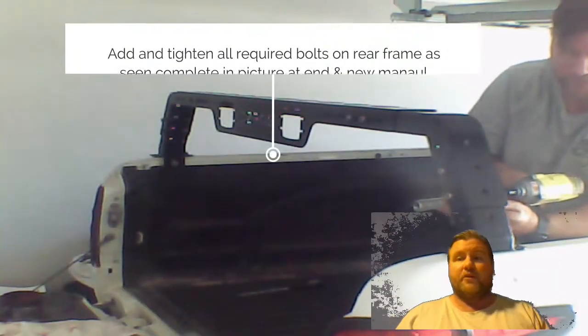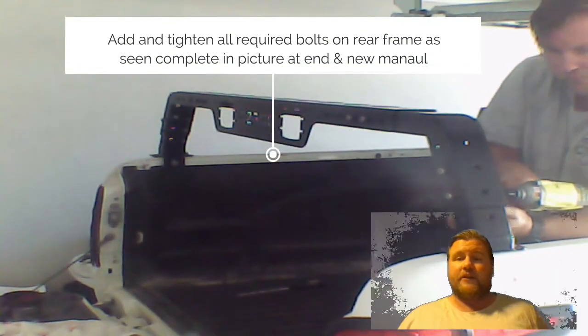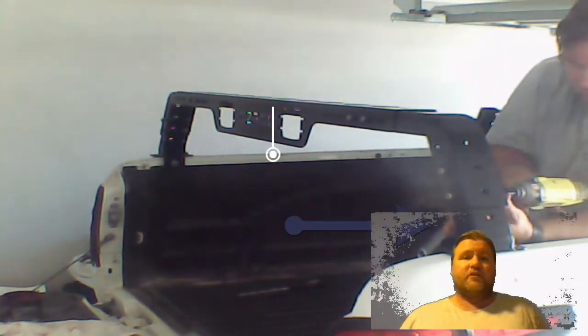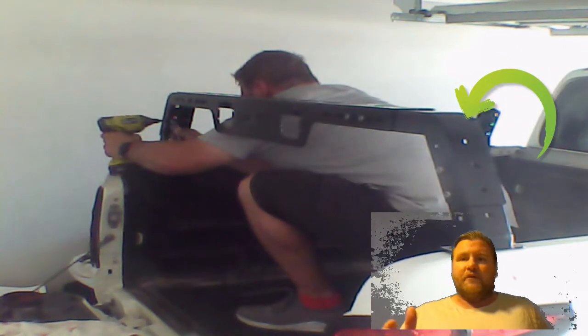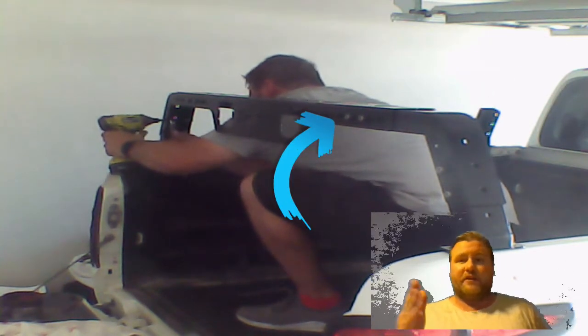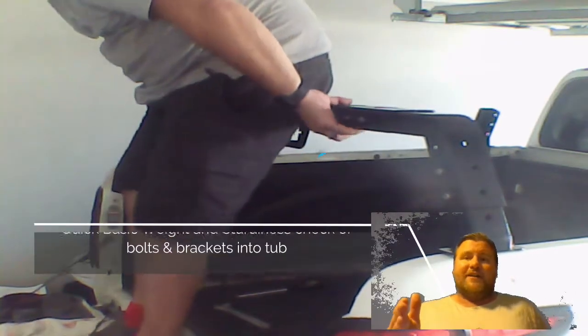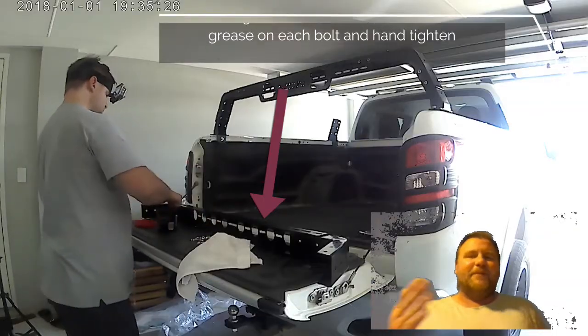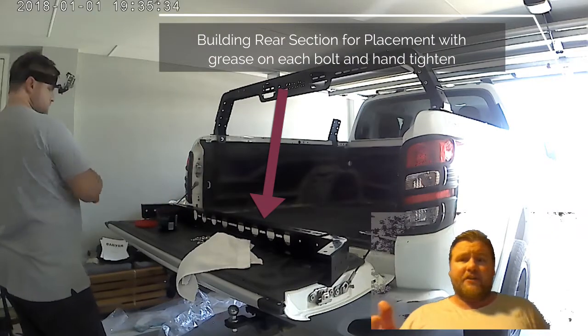You essentially have four of the 40mm long bolts and eight of the longer versions. Now I'm bolting it down to the tub itself properly rather than just hand-tightening it. I prefer having the actual bolt facing up and the nut underneath, but due to the gap issue sometimes you have to have it the other way around, which you'll see later. That was just to show you the brackets going on — at that point the bracket should be on.